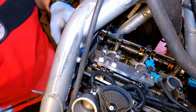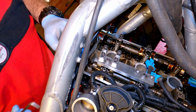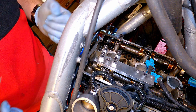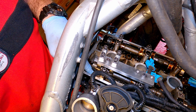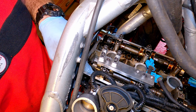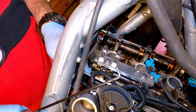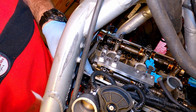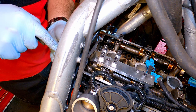In theory, you're only supposed to use plastic or soft tools to pry the shims out, but that never really worked for me. Obviously, a small, narrow plastic tool will just break trying to pop the shim out. You can use compressed air right in that notch, and that'll often pop the shim out. But if you use a pick like this, which I often use, only use it on the side of the shim, never on the faces of it. So let's see how this works.